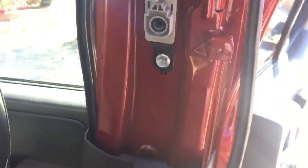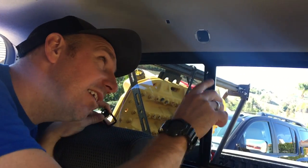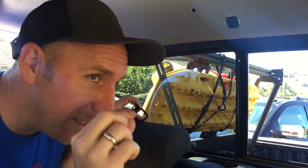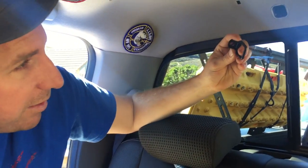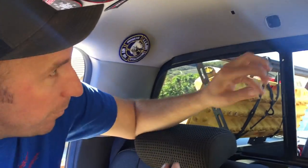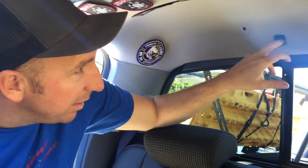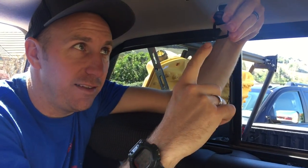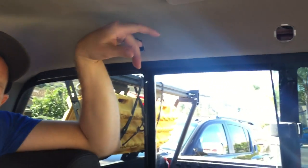So the backboard — there's just a little 10 millimeter nut in there with a stud that you screw the nut onto up inside there. This little piece right here — you'll pull that nut off, and once you get those two little panels off, this moves right here and you'll be able to fish your fingers in from behind to work up in there. Slide this thing in there on the stud and then put that little nut on — that'll be your rear anchor point.